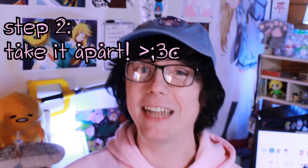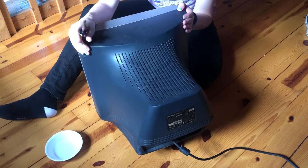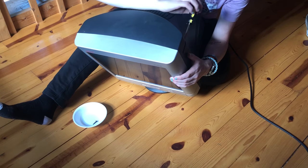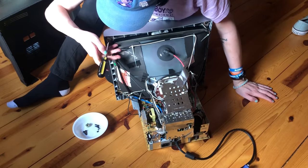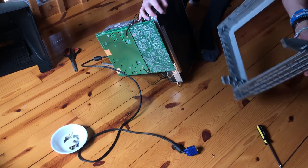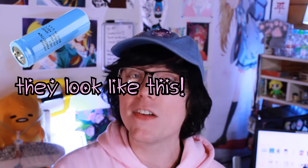Now that you have your monitor or TV at home, we get to take it apart. This part is actually fairly simple. There are usually four or five screws on the back that come out, and the rest is just the whole thing falling out. As you can see in my video, I had a little bit of an issue, but as long as you're careful it should go pretty smoothly. A note about being careful: there are massive capacitors on the inside that, if your TV's been turned on recently, please do not touch them. Make sure you ground yourself — they can hold massive amounts of voltage and you can get pretty seriously shocked. Avoid the capacitors.